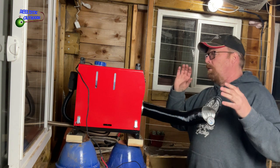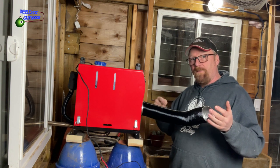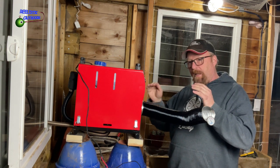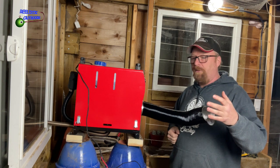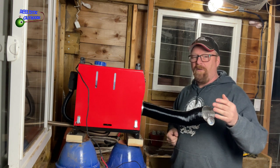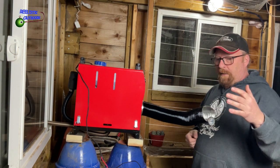One thing to note that I don't know enough about yet on this controller — this is a very new one on the market — is whether it has the low voltage battery shutdown. It's wickedly important that you have enough battery for the cooling cycle, otherwise you can damage the actual firing chamber. Because it gets so hot, it needs to be cooled. When you push this button to shut it off, the flame stops, the pump stops, but the blower will keep going until the temperature sensor says it's cool enough to shut down. If you shut it down because of a dead battery and it doesn't have enough power to cool it down, you'll actually damage the housing.